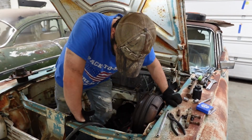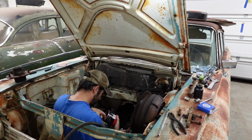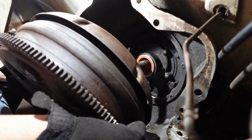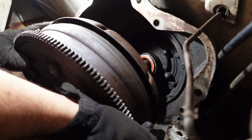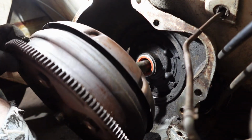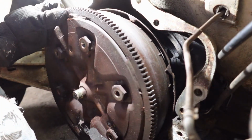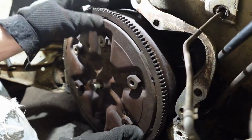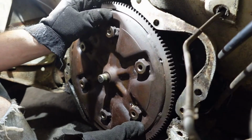Okay, I think I complained there about stepping on the bumper. I don't like bending it. And then I put a dab of grease on my finger to grease the seal to prevent tearing while installing the torque converter. Okay, here we go. This is the final go at the install. Get ready for this sweet riveting action.